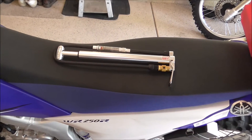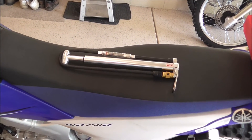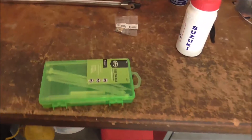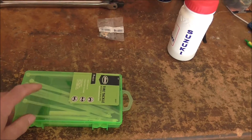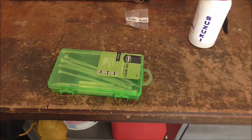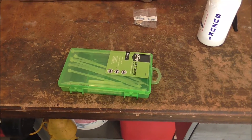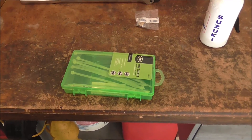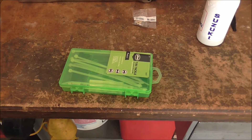Anyway, I bought the pump and was able to check my tire pressure every day. There were a couple days I didn't even bother because I realized the lowest it ever got was 95 PSI, and that's more than sufficient for the inner tube to act as a beadlock. The only other thing I brought in my backpack was a tire plug kit — I got this one at Walmart, I think Slime makes it. It's got the tire plugs and the tools to plug a tire. If you get a flat with the tubeless tire system and it's a puncture in the tire itself — since it's now a tubeless tire — you can use the same plugs you'd use on your car or truck to fix a flat. Thankfully I did not have any punctures and didn't have to use it.